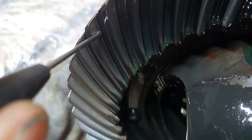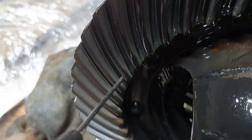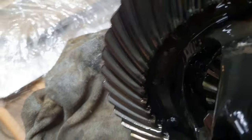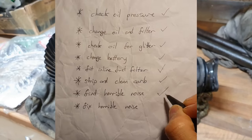Huge lip there, and I can pick it up with a screwdriver. So that's when you come off the gas - this is the side which has the wear. The wear looks quite good there actually, but it goes all the way to the end here as well. There's definitely metal being removed. You can see this surface - it's gone through the hardened surface. So that is dragged, it's going off to Ashcroft.